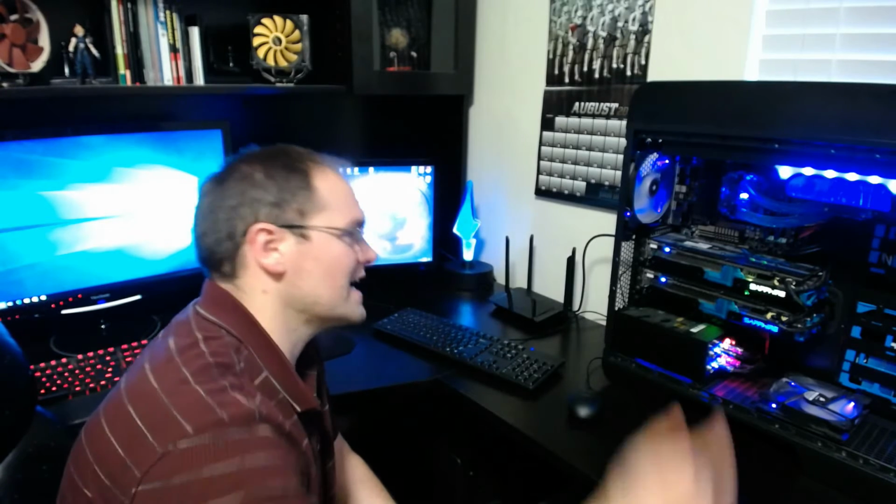Now let's go back into the performance. Okay guys, there was one thing that I forgot to mention on the install. There is one cord that comes off of that little hub that goes into your motherboard. Just a little 3-pin fan header, and that's just to help measure the speed coming off of your CPU temperature. So if you plug it into your CPU header on your motherboard, then that'll help control the speed. That's what actually controls the speed on your pump and on your fans. So don't forget that. One little tiny cord, snake it up, attach it to your motherboard, one of the CPU sockets, or if you only have one, then the one. And that'll help control the speeds on your unit.